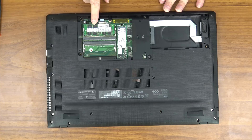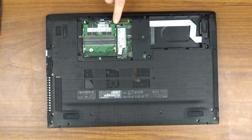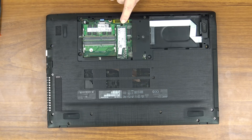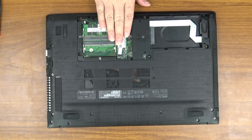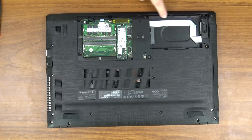Because this laptop uses DDR4, or double data rate 4, in theory this laptop will go to 32 gigabytes of RAM, but that would be rather overkill for a dual-core laptop. So 16 gigabytes is all I recommend. Next to that you have your M.2 solid-state drive — this is the 256 gigabyte solid-state drive the machine comes with. It is fully upgradable; there's a screw, you simply undo it, it pops out and slides out. We're not going to mess with that today. Over here is your hard drive bay — a two-and-a-half inch bay for a hard drive or solid-state drive. I will show what to do with that in another video.